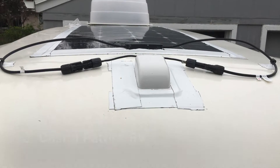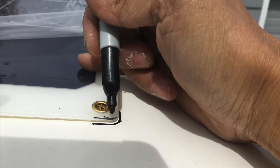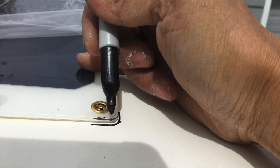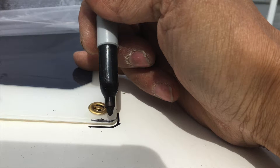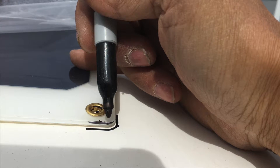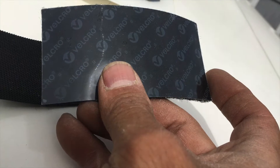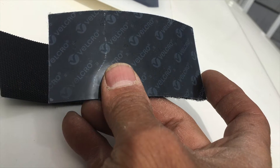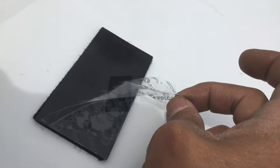The flexible solar panel rooftop install on my Casita. First I placed the HQST flexible solar panel centered on the roof of my 13-foot Casita Patriot. Once positioned, I marked the edges with a Sharpie. I'm not worried about marks as I will be covering the edges with EternaBond tape anyway. I then stuck some industrial-strength velcro with a sticky backing in order to hold the position of the panel on the roof so it wouldn't move while I applied the tape.